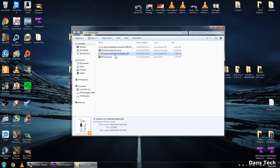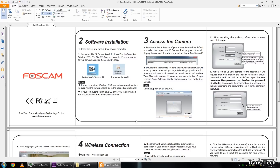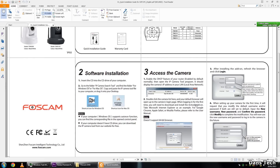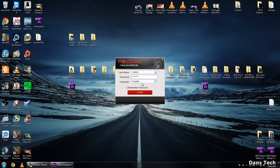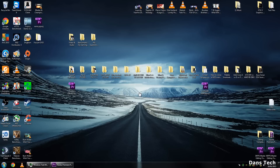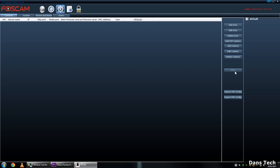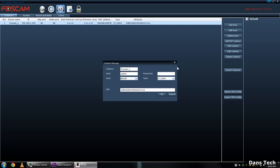Foscam includes a quick installation guide and the user's manual, which should get you going. It covers everything from remote access on a mobile phone, to wireless setup, to just setting up the camera by typing in the IP address using the IP camera tool. Once you've done that, launch the Foscam client. When you first install it you'll be asked to create a username and password - in my case it's just admin and admin. Go to the settings tab, click search cameras, and the camera should pop up. If it doesn't, simply click add camera and type in the UID for the camera.